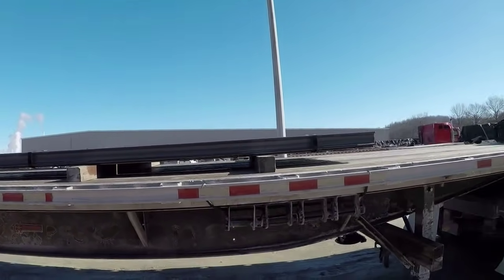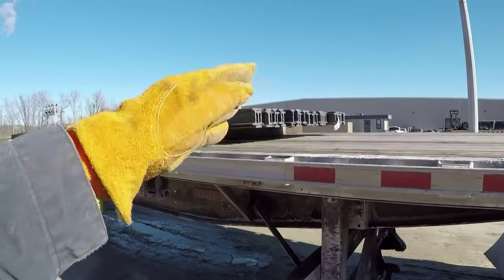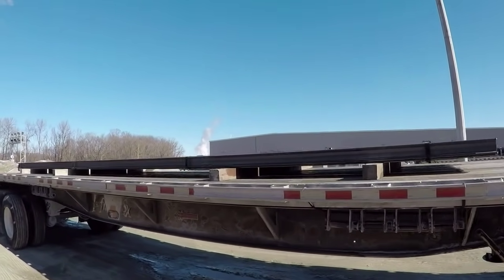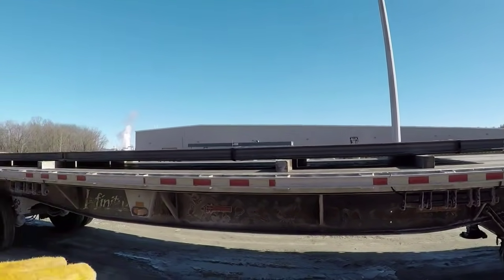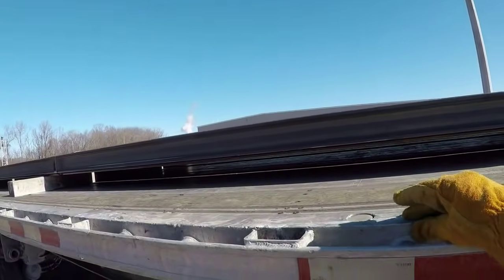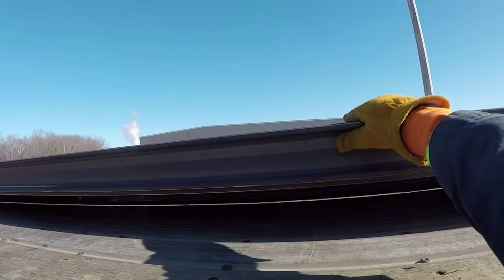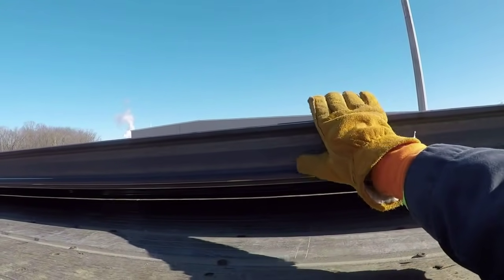What we're gonna do is go ahead and get the rest of the lumber to build a little bulkhead, because there's not much weight holding this down — just in case. So we're gonna put a little bulkhead in the front, throw a couple straps, and then put the tarp on and strap the tarp down to the load since it's so low to the deck. We'll get some edge protectors on the corners so the strap doesn't pinch the tarp.